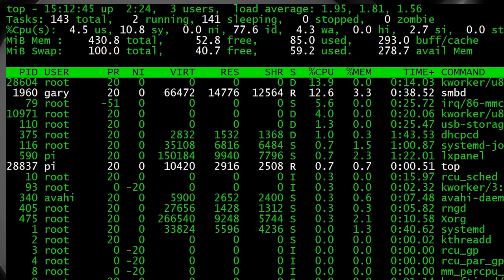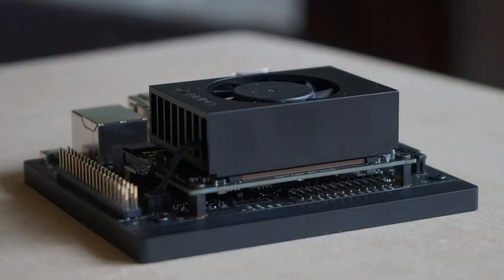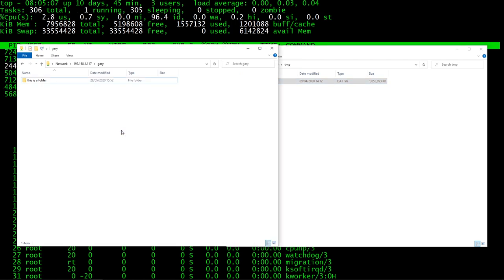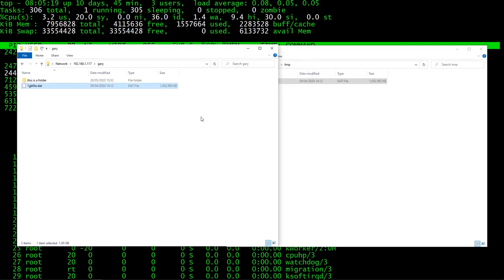And now here we are on an NVIDIA Jetson Xavier NX, running Ubuntu. I went through exactly the same steps and they work identically. This board uses wired Ethernet and USB 3 to the hard drive. Copying the same 1 GB file — wow, 113 MB/s, completely flat, no struggle at all. So clearly the USB connection, networking, and CPU power all matter, but you can use any device to turn a hard drive into network attached storage — it just depends on what performance you'll get.